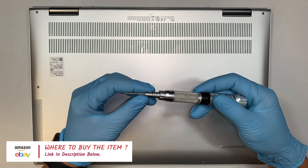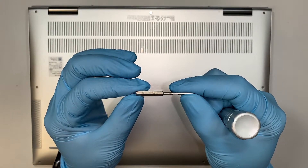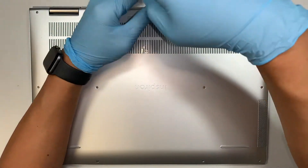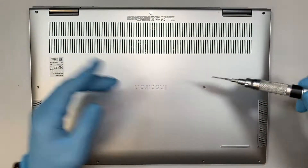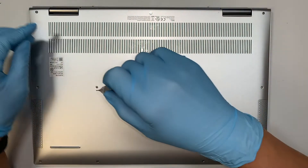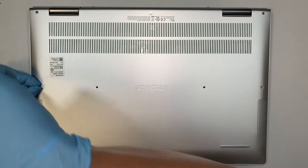You do need to have a Phillips screwdriver — this is the PH000 screwdriver. Let's go ahead and remove the screws. The three screws on the top do not come off; as you're unscrewing and you hear the little click, you should stop at that moment because it has already reached the maximum. The rest of the screws in the middle and the bottom do come off, so make sure you put them on the side. It's okay if you mix and match the screws because they are all the same size.